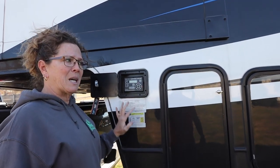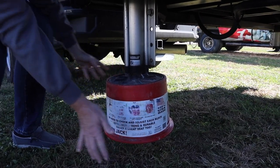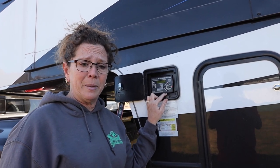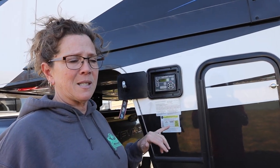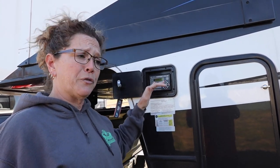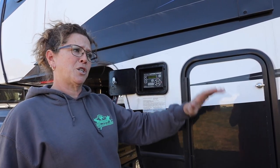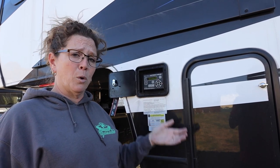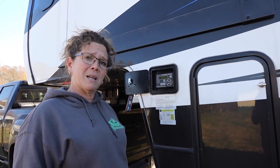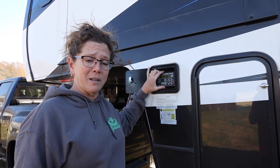To answer Steve's question — because the front still needs to come up to be level, I definitely know I have enough room to put my Anderson buckets under the front feet. If the reverse were the case and the rear needed to come up, there's a good chance I won't have enough room for the buckets in the front. As we mentioned previously, the leveling system process is: once you get it off the truck and tell it to level, the front drops down first, then it drops the jacks on the driver's side until they hit the ground, then the other side. It works side-to-side level first, then raises or lowers the front for front-to-back level. The problem Steve was having was his front end needed to come down, so when he put the buckets in it didn't have enough room to drop far enough to start that process.